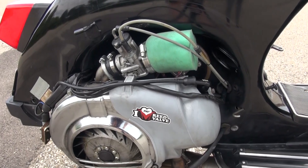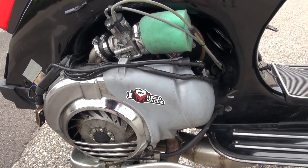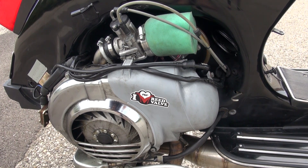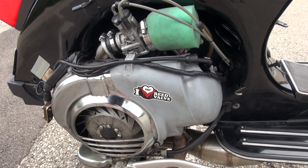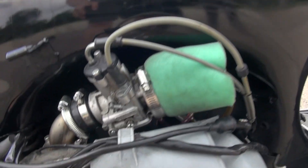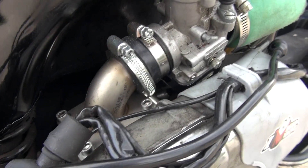While my buddy was doing all this nice cleaning up the paint, I did the engine. The engine is a Malossi 166 which has been widened to 68% width of exhaust port. It's been ported to 131/191 timings with a 60mm crankshaft. It's got the MRP intake with the reeds and the PB 30mm carburetor, as well as a P200 primary transmission with a short fork.